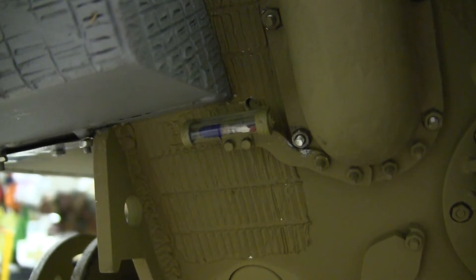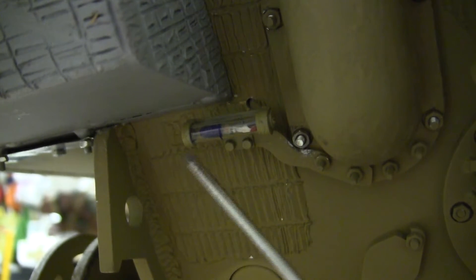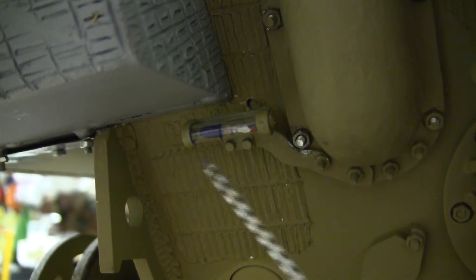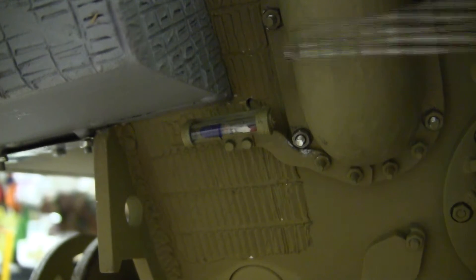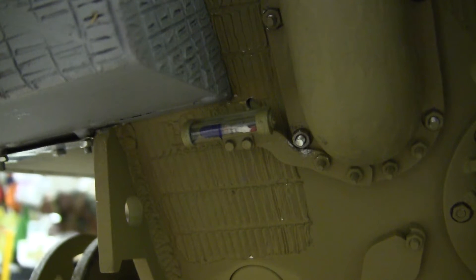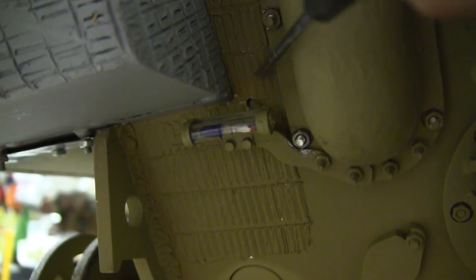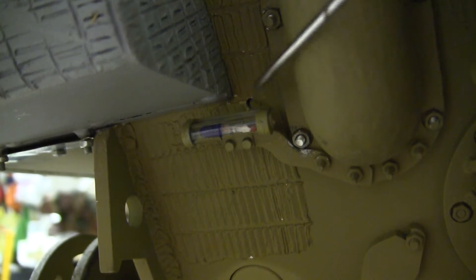The tail light and the headlight are both aftermarket and they come pre-hooked up and pre-assembled. The vendor gives you a small length of wire encased in shrink tubing, which is a nice feature. For the rear tail light, you only have to drill a small hole into the rear portion of the hull where the cable would emerge.